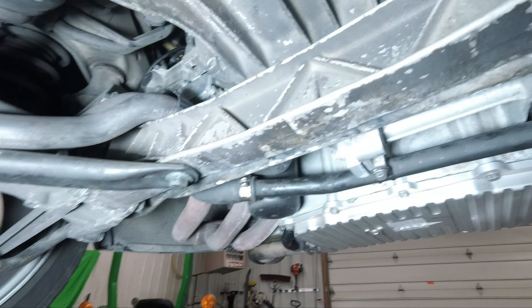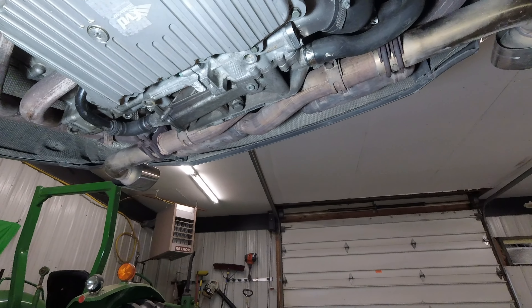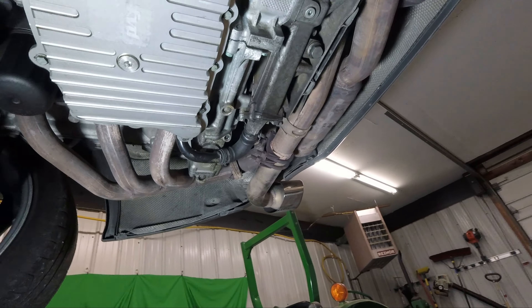I think what happened there was that plate has bolts in the top left and bottom right corners. Since I was using the old gasket, I thought I'd just over-torque it a little bit. I over-torqued it by a couple newton meters, and I think it torqued down the corners and lifted up the other two corners that aren't bolted down. Once I noticed the leak, I re-torqued it to the proper setting, and my guess is it dropped those two corners back down and allowed them to seal. Everything else looks really, really good. I'm not seeing anything concerning whatsoever.